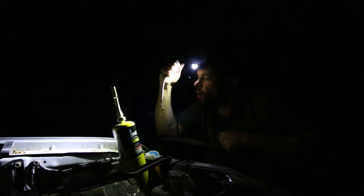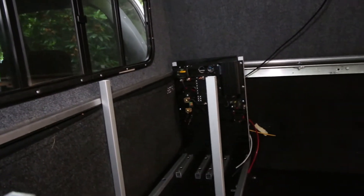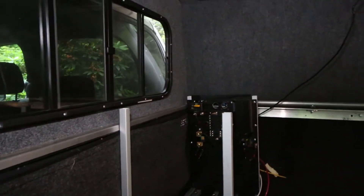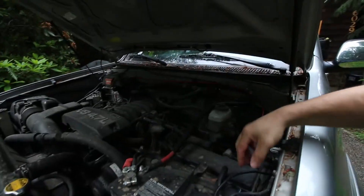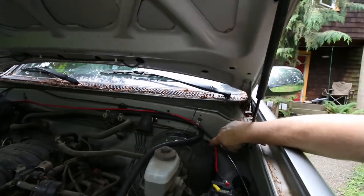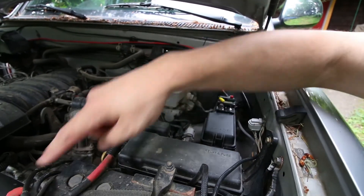I love working into the night — it's a really nice night out. Got the battery system kind of put in place, all the dual battery components put in place there. Those two holes in the top were for DC 12-volt plugs, but I just didn't find them out right — they landed right in the spot where it was going to butt up against the side of the habitat, so I had to take them out. I've got ground going right here and power comes from the back as well along the frame. I'm going to encase all that in split loom. I'm going to take you underneath and show you where I ran the wires.